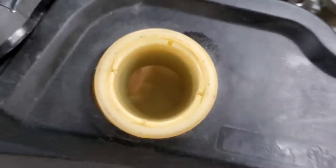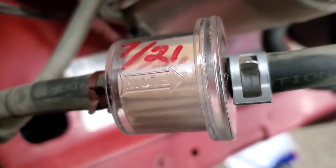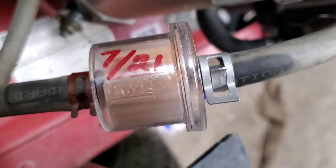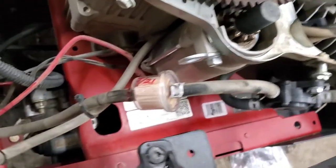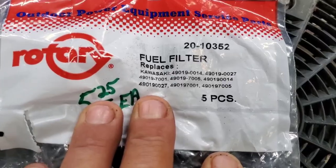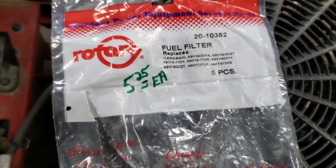We just cleaned this tank out. I'll put a link in the description — I think Harbor Freight sells an oil extractor that you can buy. We went ahead and put the new fuel filter on, and you'll see that it is directional, so that way you can see if there gets water and trash in the filter. I also date them — I put July 21 on there, and if it has an hour meter I'll write that on the filter also. I do the same thing when I'm changing oil. These are the fuel filters that I use: 10352 fuel filter. It says for Kawasaki, but I use them on everything — Rider, Kawasaki, Kohler, Briggs, I don't care. I put it on all of them.